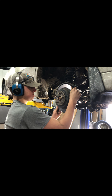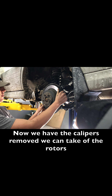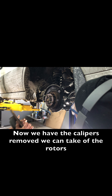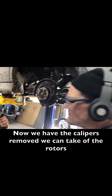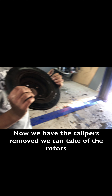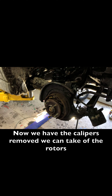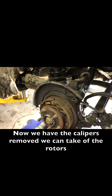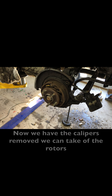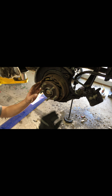Up on the top. So let's raise this up. Look at that — it's barely touching. And then the other one you've got to go through that frame up under there. So there's plenty of brake shoe left on there. What we're going to do with those pads — we're going to find the adjustment for your e-brake and tension it up, instead of doing anything else with it.